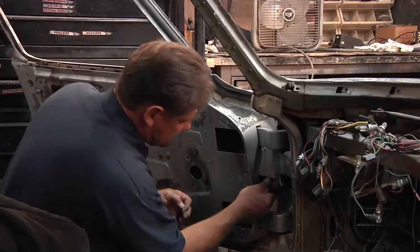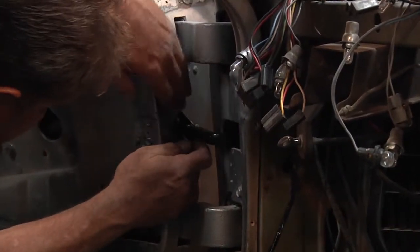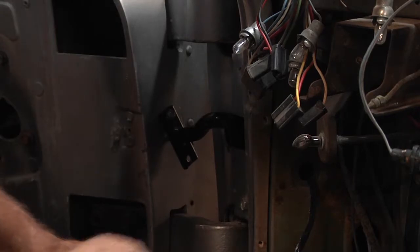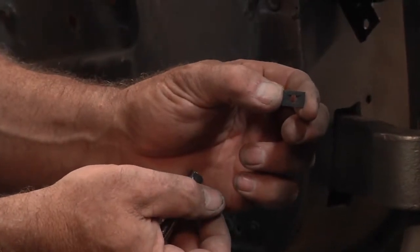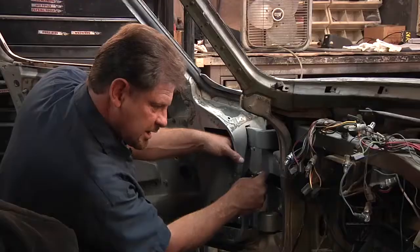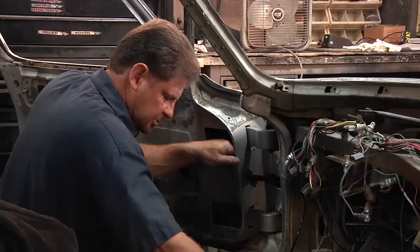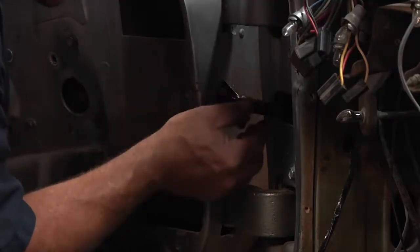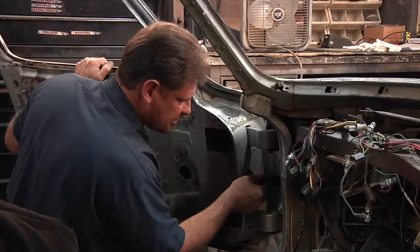Once you feed it through, there's a pre-existing hole on the inside of the door and also the three-quarter inch hole you've drilled. It's just about directly behind there — it goes in and makes a quick right turn inside the door. Feed your harness through there; you can reach through the door with your other arm to grab it. Now that we've run the wires through and drilled our holes, we're going to mount this bracket to the door using the provided self-tapper screws with a 5/16 head. They also come with a little flat spring-loaded clip that goes on the inside. Before you get it totally tight, maneuver the bracket to put in your second screw, then double check that it's not hitting on the inside. Bounce the door a little bit and feel if there's any tugging on that tube.